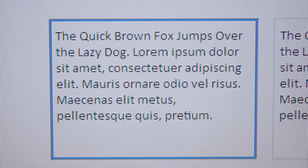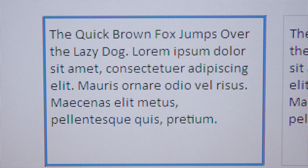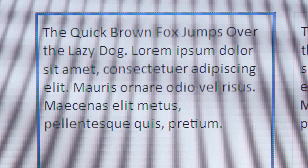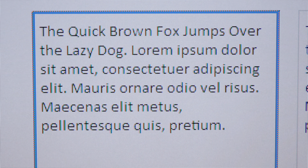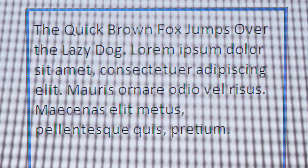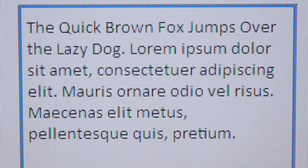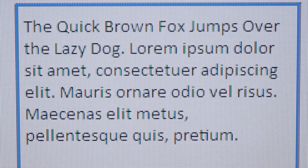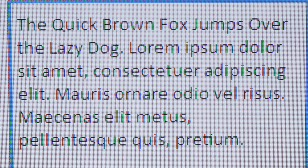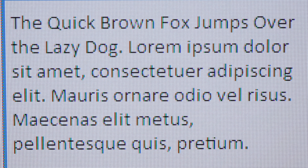In terms of text clarity, it's actually not very good. This is the one unfortunate part about having such a large screen with what I'd consider a lower resolution. It would be much better if it were 5120 by 2160 or even 3840 by 1600 — a massive improvement in text clarity. W-OLED already has inherent text clarity issues because of its extra white subpixel causing fringing on the edges of text, and this is only exacerbated when the pixel count is lower than 4K stretched out onto a large screen. So I'm not sure this will be a great display for productivity work.